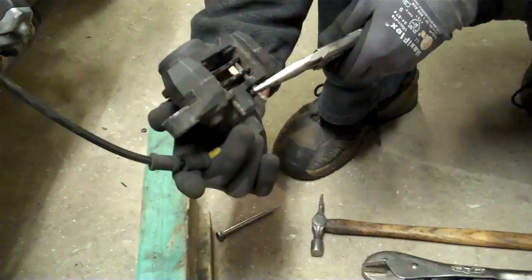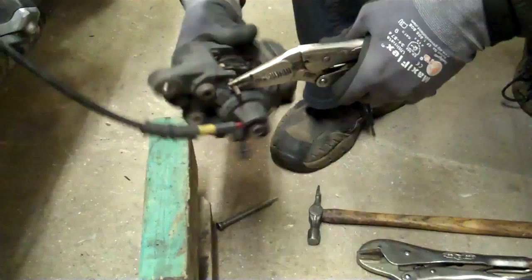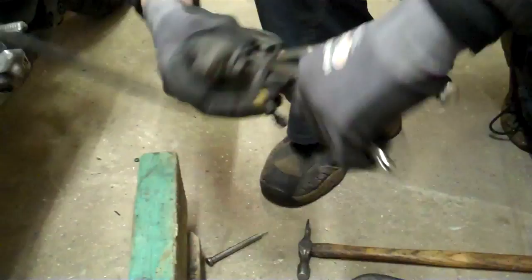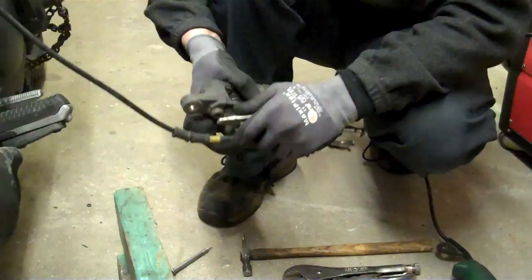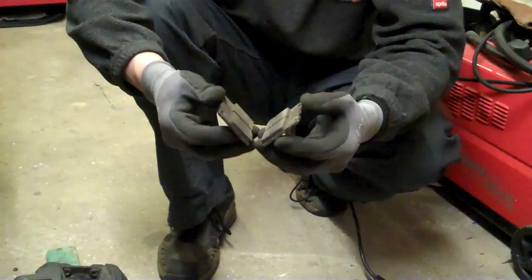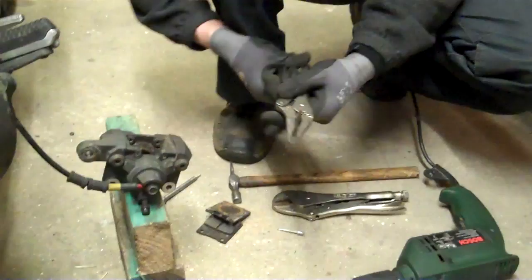And there they are — there's your two pins. You can cut them and put new ones in, but a pair of those is about eight pounds. Why waste money on two pins when you can get them out like that? It's just one of Suzuki's little faux pas — a notoriously bad design. That just leaves us to drop the pads out. As we've done on the other one, these are absolutely fine. People say why not put new pads in — why? They're perfectly fine, nothing wrong with them, about fifteen pounds a pair. The pins are stainless so they haven't suffered. They're not sided, so it doesn't matter.